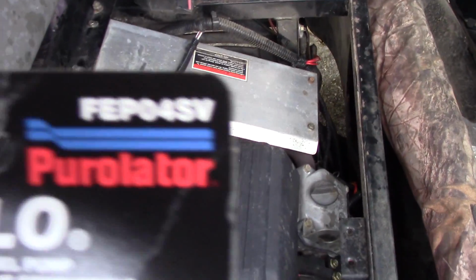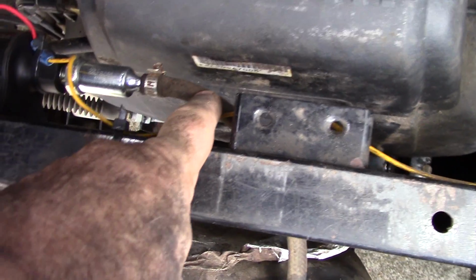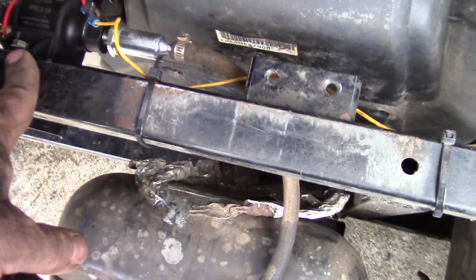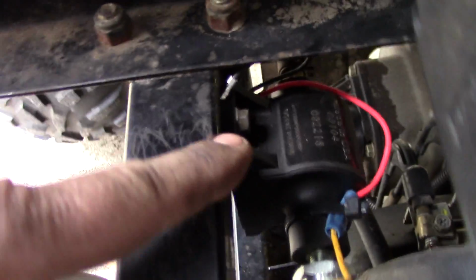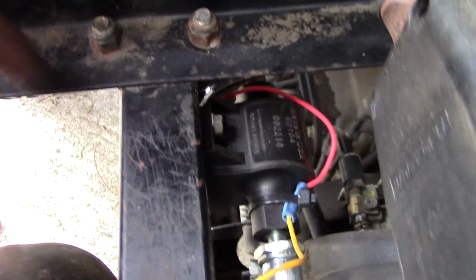And this guy right here comes with the filter. It's larger than the original hose, which is 1/4 inch, but I forced it up over there and put a hose clamp on it. Just put it up where the bolt was on the original pump. It's a self-tapper. Goes in the frame right there. I just use the same bolt, same hole in the frame, and put the ground wire on it. Okay? Alright.